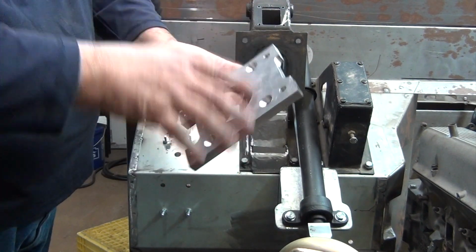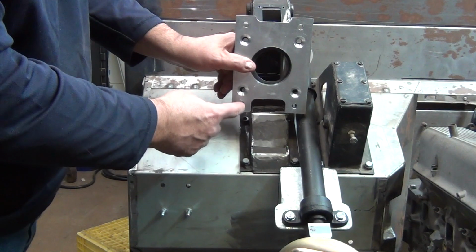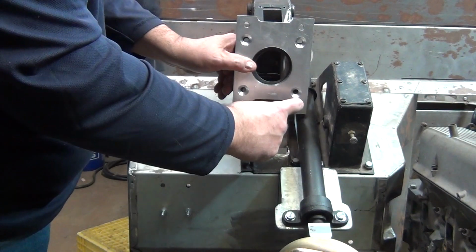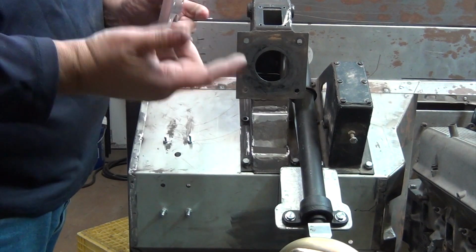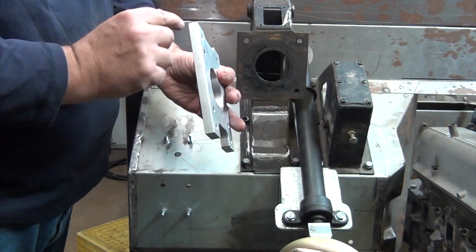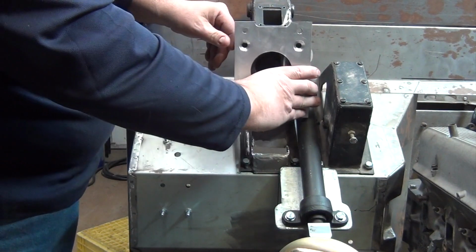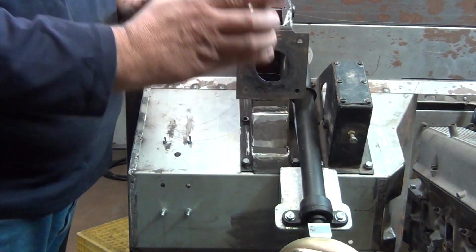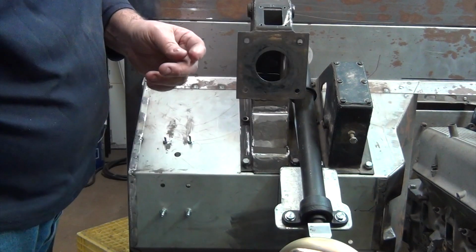plate. Now what this adapter plate will do, it will bolt into the original holes, because the Type 50 has different locating holes than the Series 3. We have different locator holes here, and in addition, the push rod that connects to the pedal is 1/2 inch longer. So we made this adapter plate spacer 1/2 inch to accommodate for that longer, so it all connects up again. So if we go that route, we have it covered, we have it prepped and ready to go quite easily.